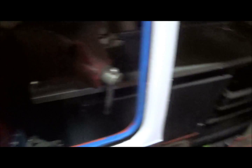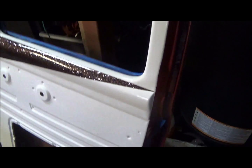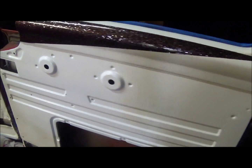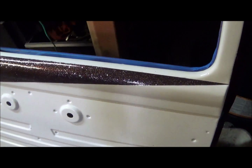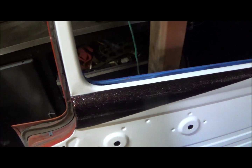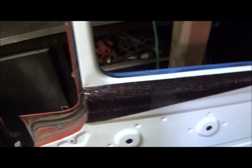Got a lot of trash right here that I'm going to sand out real quick. On both sides — this one's got some too, right here. I'm going to sand that trash out real quick and then put a couple coats of clear. I'm not going to really worry about the bottom because it's got enough clear on it to protect it, and it's going to be covered with door panels anyway. I did this yesterday, and from the looks of it, it's going to match up pretty good with the dash.